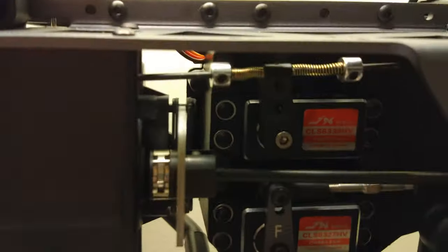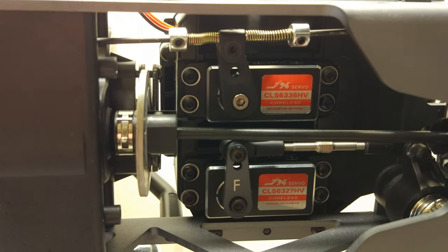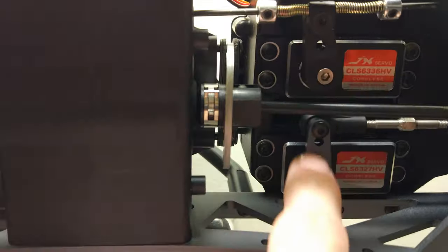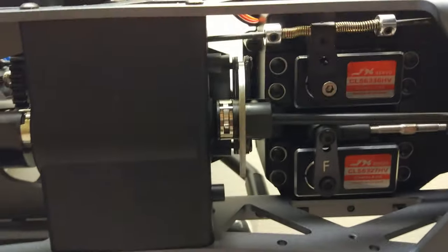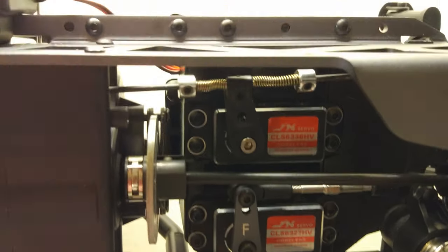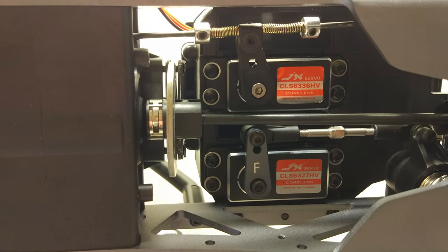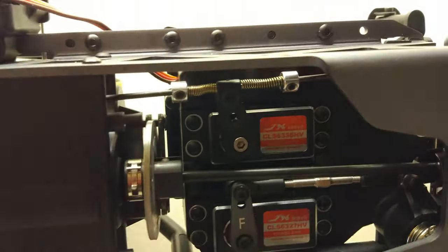You can see it's set up similar to how you'd set up your throttle servo. You've got two collets and two springs. Ideally, you want these collets an equal distance apart from the servo horn, but the way I've got the endpoints set up on channel 4 is slightly further away on one side for some reason. It seems to work okay, though sometimes it struggles to get into neutral and stays in forwards, but it's not too bad.